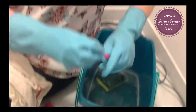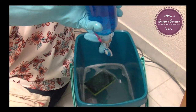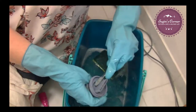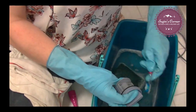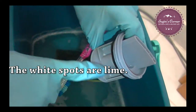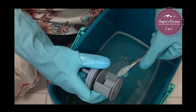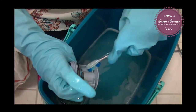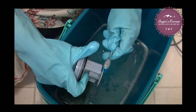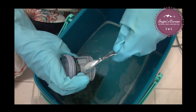I'm putting this piece in just water with a little bit of dish soap. I'm using an old toothbrush — it was cleaned, by the way. Are you able to see the sediment right here? This is all lime. This is not good to have; it can destroy your washing machine. Now because I'm seeing a lime buildup, I'm going to clean this out again, probably today or tomorrow after I do my little tablet wash, because I want to make sure all the lime is out of there.